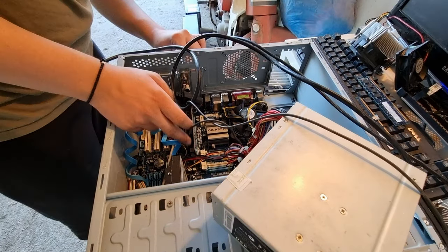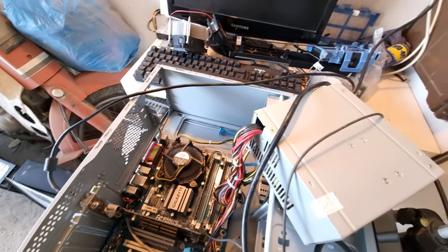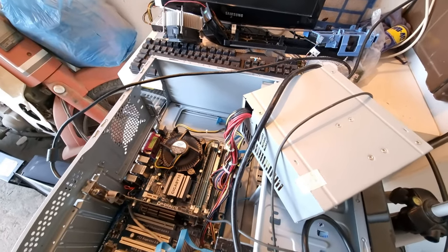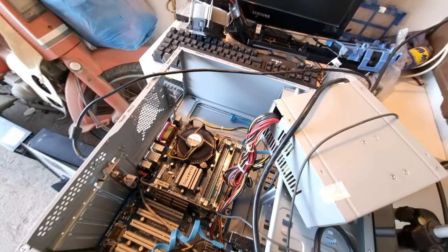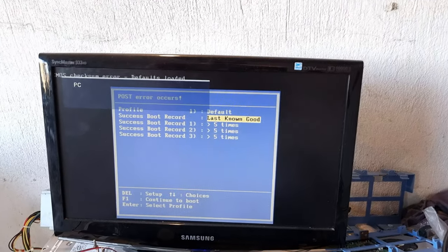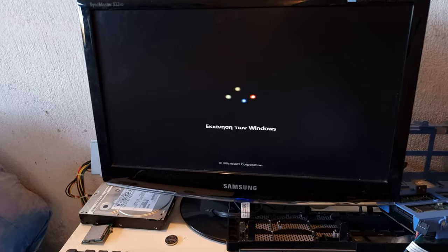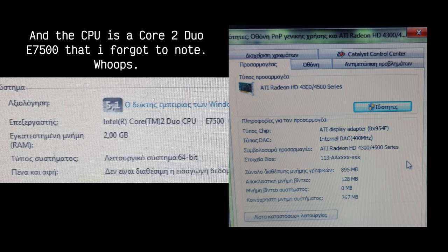After reassembling it enough to boot, I pressed the power button without any hope, and the PC turned on but was stuck on a black screen, suggesting the GPU could be bad or the board is dead. I then tackled the GPU, which somehow got the PC to post after a reboot to a CMOS error screen. After resolving that issue, I rebooted the computer and it got to Windows 7, which is a really old OS nowadays but nostalgia for most, revealing that the graphics card is some sort of an ATI Radeon 4300–4500, which is actually an ATI Radeon 4550 judging by the model number on the card's PCB.